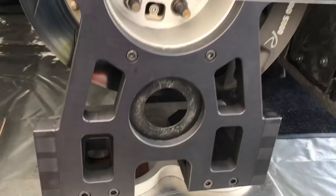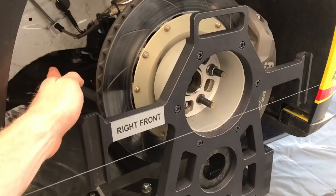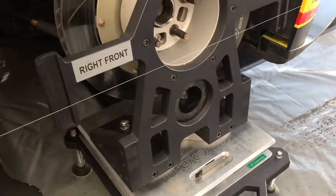I also have to explain why the car rolls so freely here. When you do the setup, the car has to move really easily. If I'm adjusting an arm longer or shorter and it's not flexible, you might push the arm into the steering and move the other tires. So it's really important that everything is really loose when you do the setup.